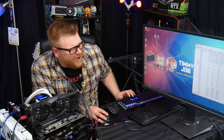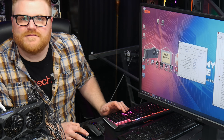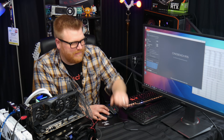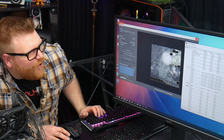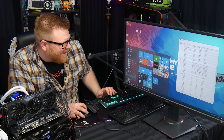Yes! We're at 4.7 gigahertz. All my memory there — that's what I'm worried about. 16 gigabytes. It sounds like not very much for this setup, but that's what I got: four 4-gig sticks of 2666 because I'm cheap. And we're seeing 104 degrees — I don't have the clamp down very well. Let's go ahead and relid it.